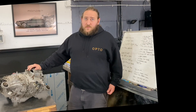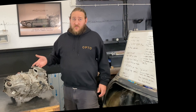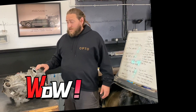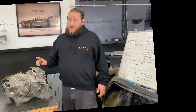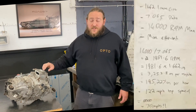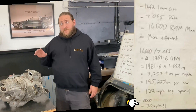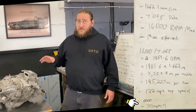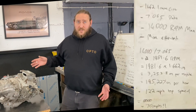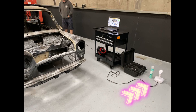With this unit we get a theoretical maximum speed of 122 miles per hour, with the motor spinning at 14,000 RPM - though that's not its optimum efficiency. Its optimum efficiency is around 8,000 RPM, which gives us a maximum road speed of about 70 miles per hour, which is much more sensible.